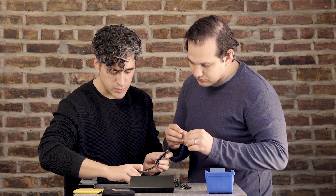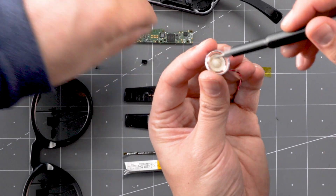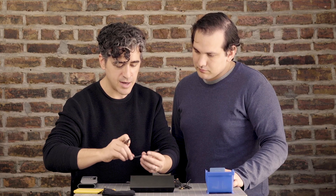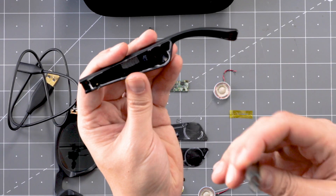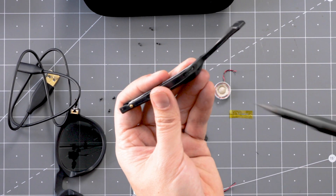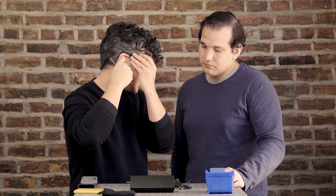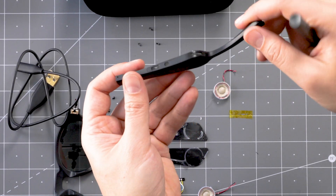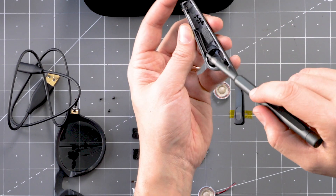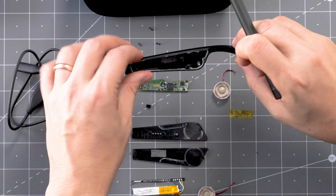The audio goes into really lovely lightweight speakers — it's a 14 millimeter driver with a lot of surface area. Air is pushed out of both sides: the front of the speaker shoots out a port that places vibrations and mid and low sounds right at your ear. The backstroke of the speaker vibrations comes out a bass port, and two other ports are routed from the back of the speaker through a hole in the housing. That might be how they do interesting audio engineering to give you a spatial sense, which is important for their AR experience.